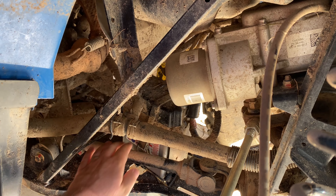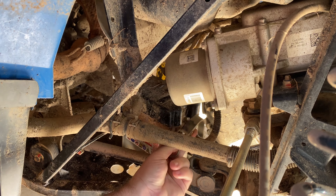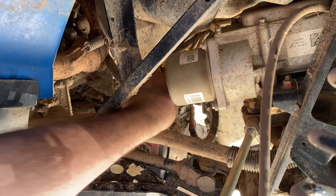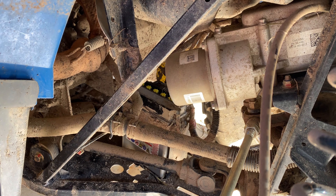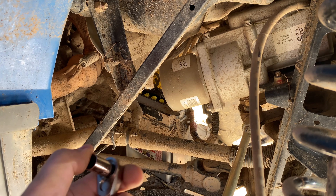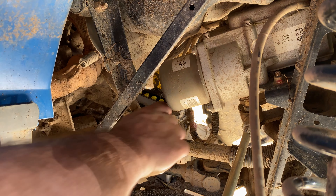If you've never taken the battery out, it's pretty simple. You just pull down this clip and pull it right off. Here's the small bungee cord that actually holds the battery down — that's really the only thing holding it. This plastic piece comes right off the top; it just kind of keeps the top clean. Then we have the terminals which we'll take off with a small wrench. Because of the tight spot, my arm might get in the way of the video. I'm going to use a 10 millimeter on this.